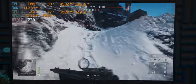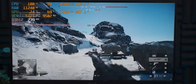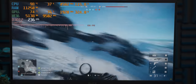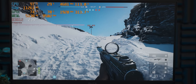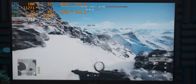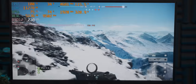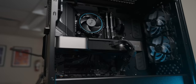Out of curiosity I did a little bit of undervolting, and we're already at 100 degrees Celsius — so I don't know if that's really helped much. The average core frequency does seem to be a little bit higher, but interestingly we're also drawing more power at the same time, so I guess it's running marginally better, but we're still sitting at 100 degrees Celsius. Does it really matter?